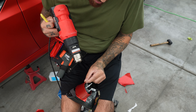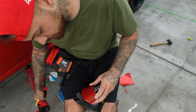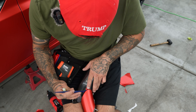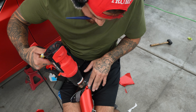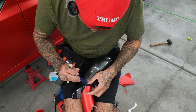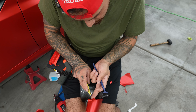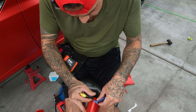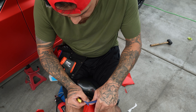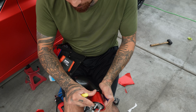I'll just leave all that material in there — I don't really care, because it actually takes a gasket and you won't ever see that. Now I've got to start pushing this in and just kind of massaging it in. Then I'll use my heat gun to relax the film, and then cut right to the edge. And here I actually want to cut a relief cut so this relaxes over. Then I want to use my heat gun. The reason I can do a relief cut there is it's going to hide underneath everything. I'm actually over wrapping it at this point, but it is fine.